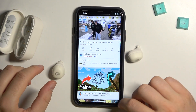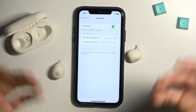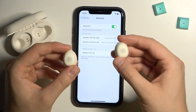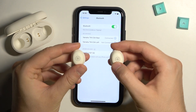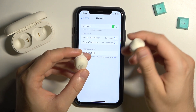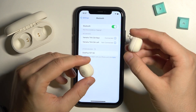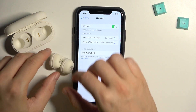When you go back to the settings, you can see the status still appears like the left ear is not connected, but it's working as you can see. That's really weird about these earbuds, because normally when you try to connect any earbuds you click and hold both until they start blinking. But with this device, when both are blinking you will not be able to connect them correctly — you'll only be able to choose left and right separately. So to make them work together and synchronize the sound, you only need to put the right one into pairing mode. That's the method for using these earbuds.